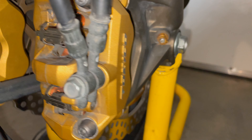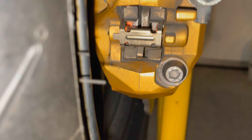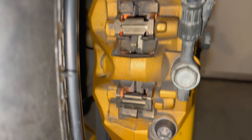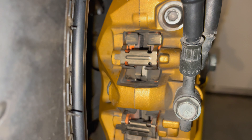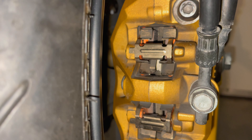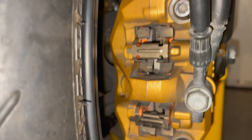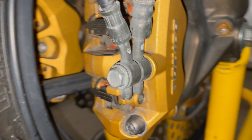Let's take a look at my work. Everything went in straight, which is good. You can see those clips are facing the right way, all of the brake pads are facing the right way, the friction material is towards the rotor — which is very important. Everything's torqued down to what it should be. Let's check the other side — looking pretty good.